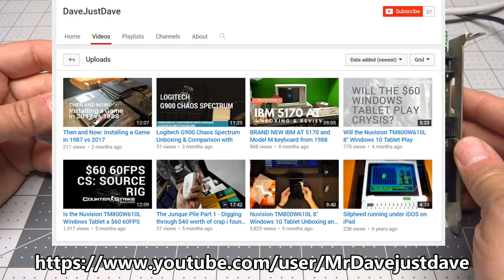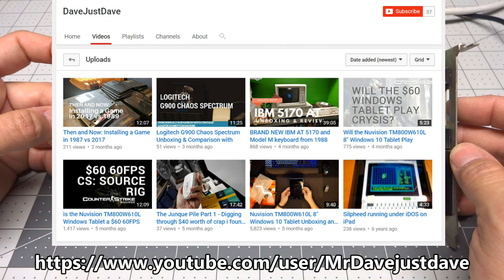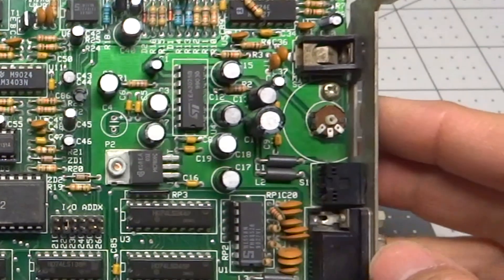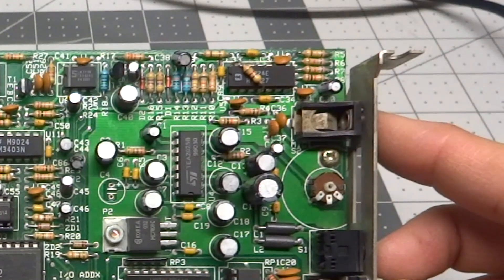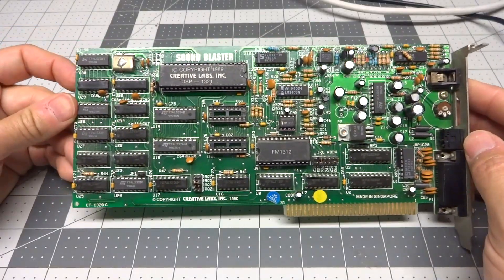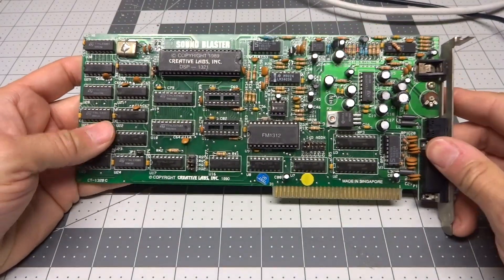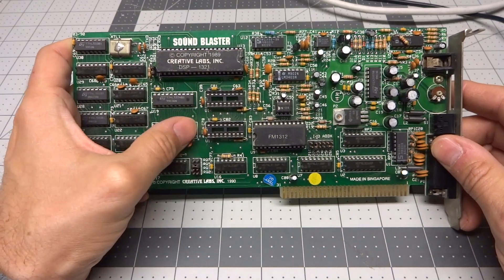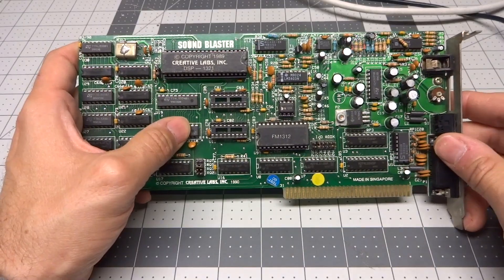I was given this card by my friend Dave — Just Dave. This was his actual card from when he was a kid and we were both in junior high. It's a little worse for wear: the volume knob is broken off, though you can still turn the shaft to adjust the volume, and the microphone input is blown out because he accidentally put speaker-level inputs through it. The rest of the card does work perfectly though, even though it's been kicking around in a box the entire time. When I got this card and realized I just had to add the two Philips chips to these sockets to get CMS support, I figured I had to find those chips and give it a try, since I'd never heard this sound system.